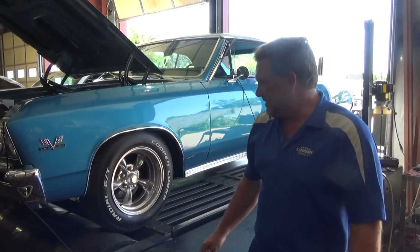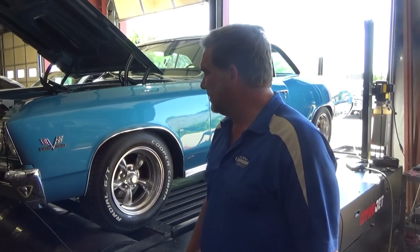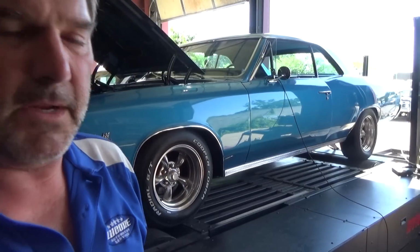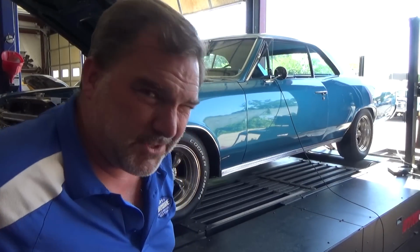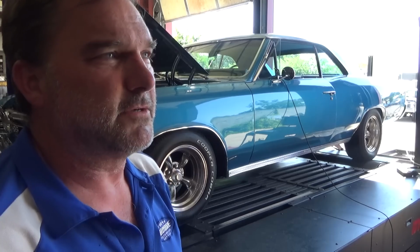I wonder if this thing's moving the roller up front. I'll strap it down a little more in the back and see if I can get this. This wasn't happening earlier, so I must be making more power. Alright, so all my straps in the back have stretched a little bit, so I got a couple clicks into all of those. We'll see if that eliminates this fault from happening on our dyno. And we'll make this same pull again for 2 degrees more timing after the brown cam changed.